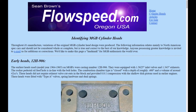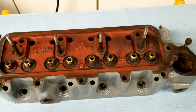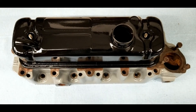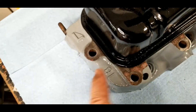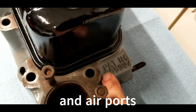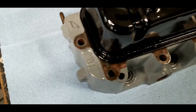Let me drop an insert here of the head I currently have. This is my head right here, and you can see that it is a 2923. But looking at it from afar, let's pretend the car is put together. If this is in the engine and you wanted to see what kind of head it was, you wouldn't be able to read the etching on the inside. But you could derive from the '18' and the 'L' and the patent number being on the outside, and the lack of a water jacket valve, that this is the 2923.